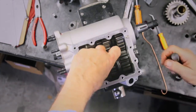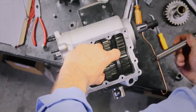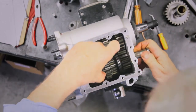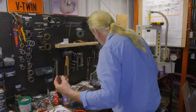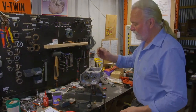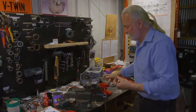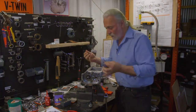As we line up on our sprocket side, place our countershaft itself in, not quite all the way through. Now our selected thrust washer, and then I recommend you fabricate a form of a heavy wire with a hooked end, in this case some form of welding rod, or a heavy gauge wire as I say, so this doesn't drop all the way through.